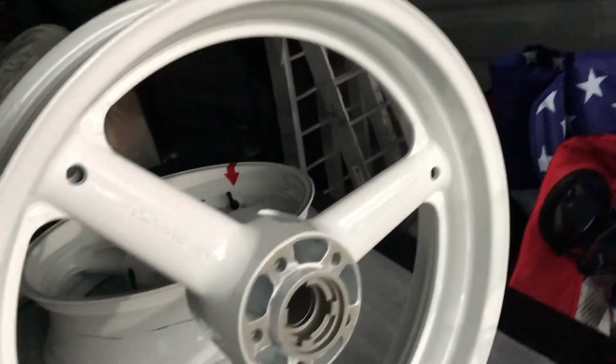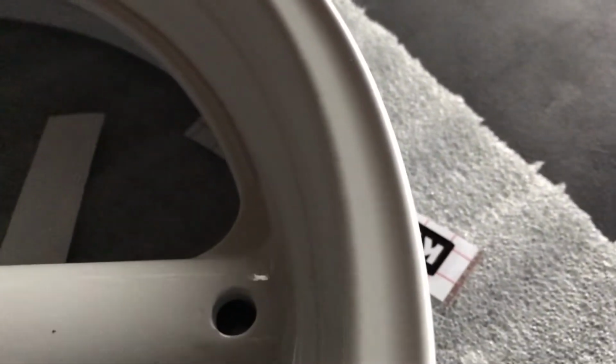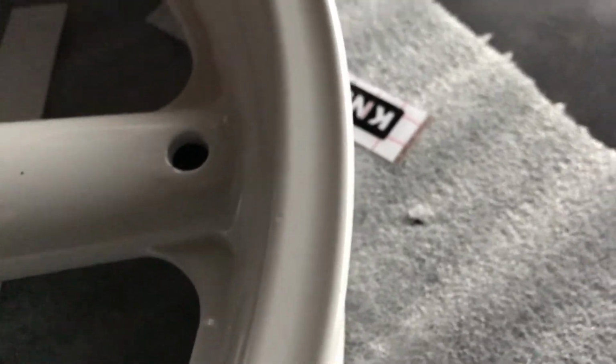You find out the rotation of the wheel. Like we said before, if you're an SD guy, you know the speed sensor is on the clutch side, so the wheel is going to be rotating this way towards me. The arrow goes towards me, on the opposite side of the valve stem, so I know that it is down, opposite side towards me, so it will be going this way. And we'll keep it across from the valve stem. Work it on in there. Wow.